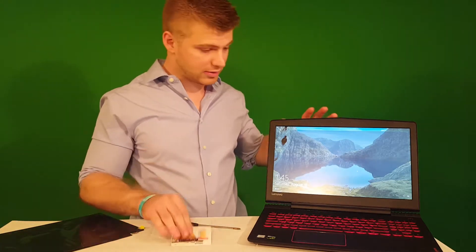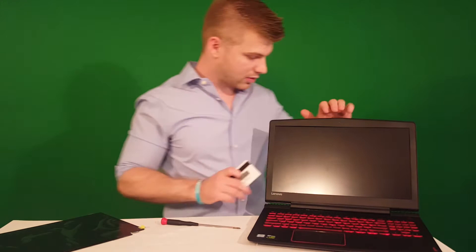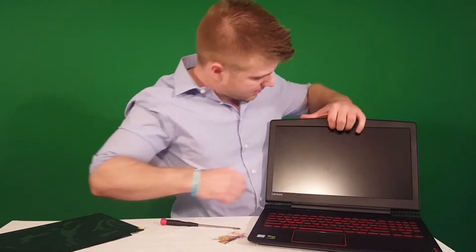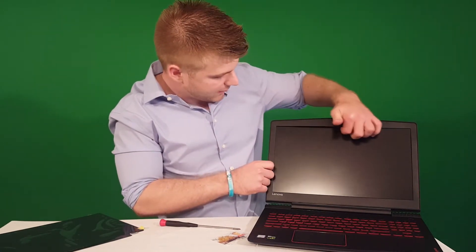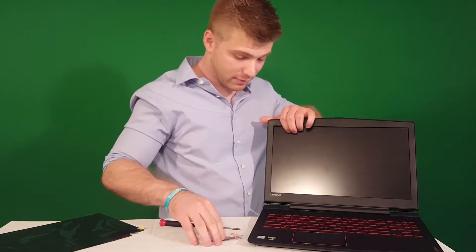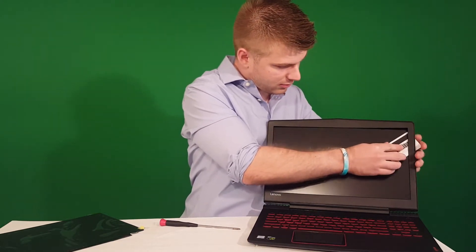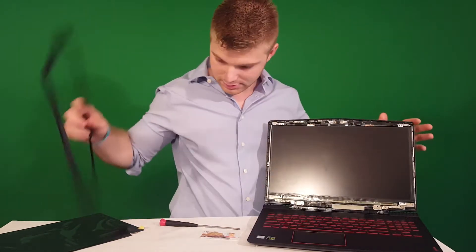Really, really simple fix. As you can clearly see, this is a working laptop. What you want to do is power off the laptop. Then you want to remove this little outer rim right here. I've already popped mine open a little bit. If you can't do it, stick your fingernails underneath it and just pry it off. Sometimes it takes a little bit of force. You can also take a little card and just stick it under and slowly pop it open one by one. Eventually you'll get it off — perfect.